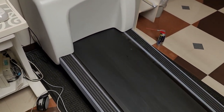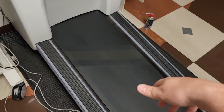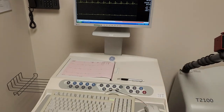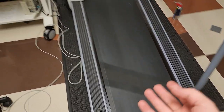I'm going to get on the treadmill and walk to spread the lubricant, then re-lubricate it and walk again. Then I'm going to run the incline up and down to check and make sure the incline mechanism is nicely greased. And I'm going to run it really fast to check the skew at high speed.